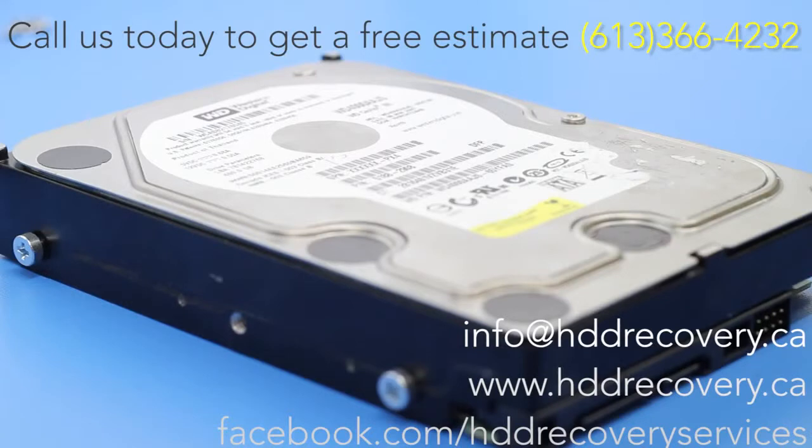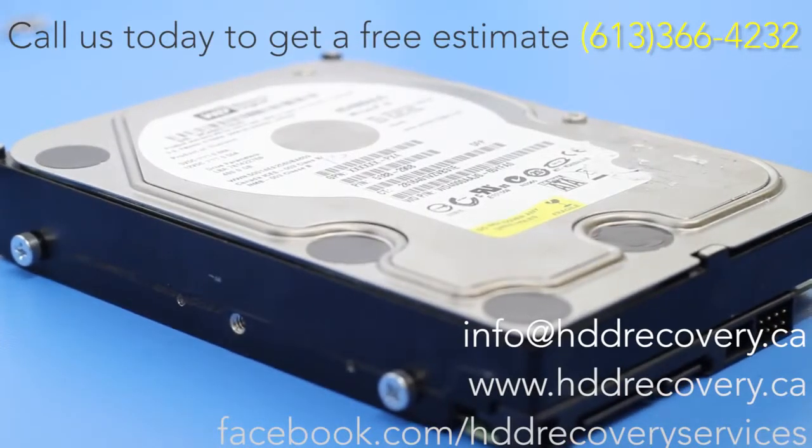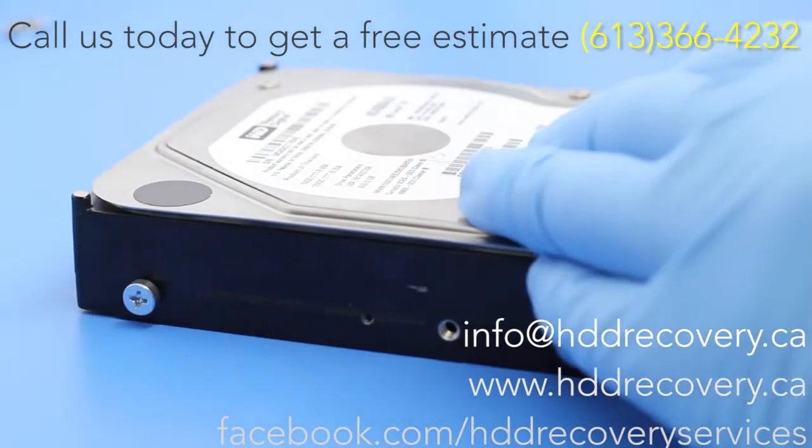It's a Tornado, which already comes with its own bag of issues. That specific family of Western Digital hard drives is pretty notorious for all kinds of failures, but head problems can happen to any drive. Like, if you drop the best hard drive out there that's super reliable versus the worst possible one, they may fail in the exact same way. So we're going to open this up, make sure that there is no extensive platter damage which could affect our recovery success, and we already have a donor drive matched up to it, so we have parts in stock for it. So let's open this up and see what's going on with this drive on the inside.